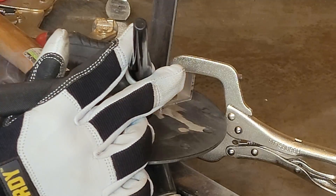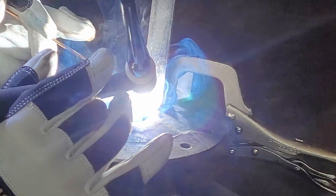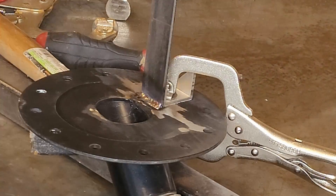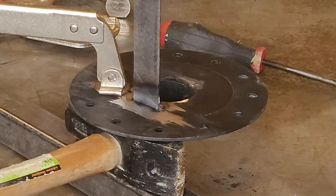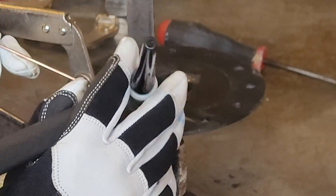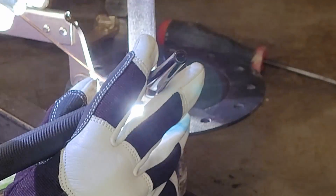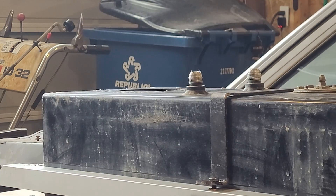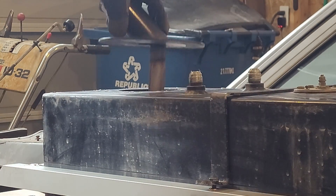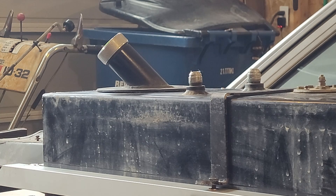This is the filler cap that came with the cell — it's steel, so much easier to weld than aluminum. Quick weld on that, and the strap is actually stiff enough that I don't need a brace for it. It should be very low vibration so I don't have to worry about weld fatigue. And just like that, we have a fuel cell mount that bolts into the car with riv nuts, and a fuel pump hanger mount — nothing too special, but nothing crazy, and easily fabricatable.